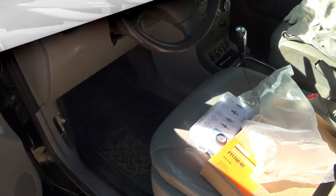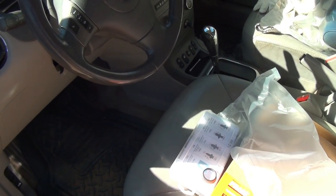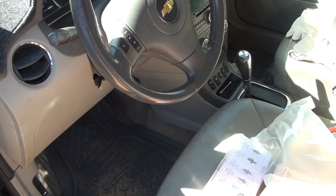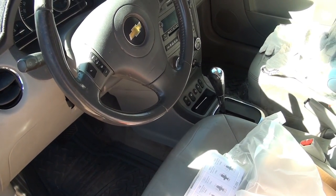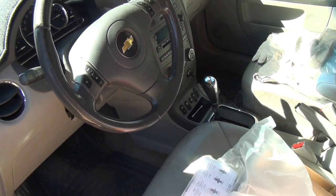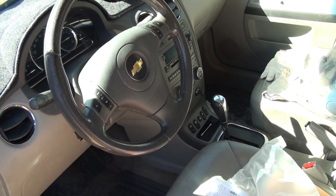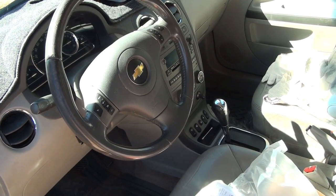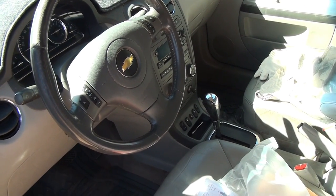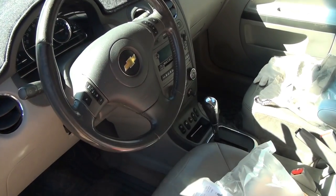I think this should make a big difference. She's all back together — I didn't film all of that. I almost forgot to say that I have to start it up, run it through the gears a little bit, and tomorrow morning I'll look underneath and check for leaks, because the transmission fluid drains down once you shut the engine off. There'll be more fluid in the pan when it's not running, and that will be the time that if it was going to leak, it would. Again, this is Steve, AZ711, saying thank you all for watching and subscribing — bye for now.